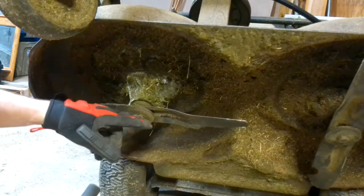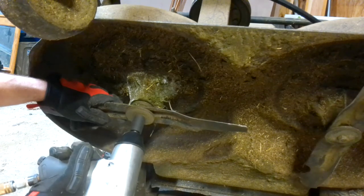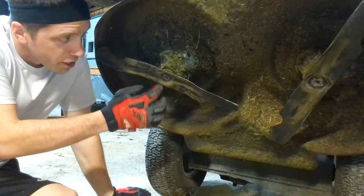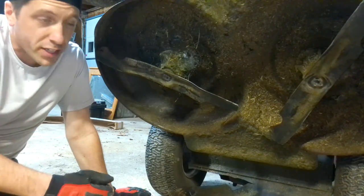Alright, then you remove the blade. There's a nut right here in the back — I like to use an impact gun because it's quicker and more fun. Now this is the funky part: I actually welded the spindle shaft to the blades here because I needed to replace them but I didn't have the parts, so I just fixed them together.